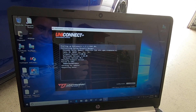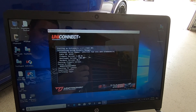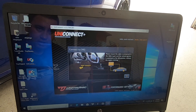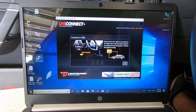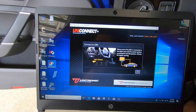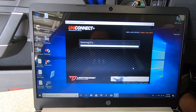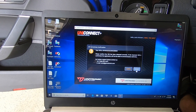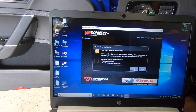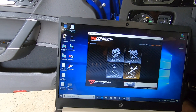Once it loads, it'll pop up the login screen. It will ask for the email and password you created, and then it'll prompt you to plug the OBD2 into the car. Connect to OBD2 — now with our OBD2 plugged in, it says please ensure the cable is connected to the OBD2 port and the vehicle ignition is switched to the on position without the engine running. Go ahead and do that, then click OK. It'll detect the ECU, then ask you to confirm your VIN — make sure this matches the VIN you signed up with when you got the Unitronic Connect cable. Once confirmed, you'll reach the main dashboard where there's performance flash, transmission flash, and diagnostic tools for both ECU and TCU.